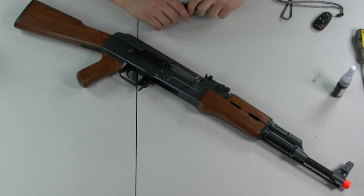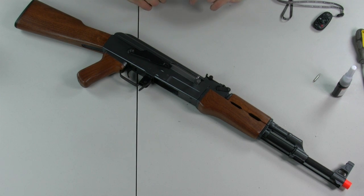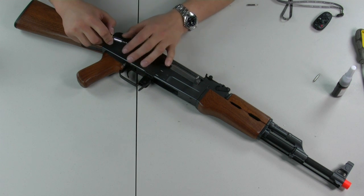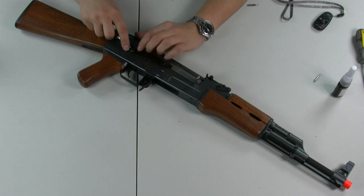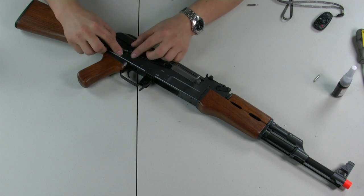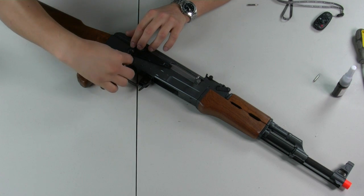Okay. So, in order to get the selector arm off, if you'll notice, there's a small round hub right here. You could pry this off with a flathead screwdriver or a prying tool, whichever you choose to use. Just when you do take this off, try and do this in a 360 motion. You want to be able to gently pry it off. You should get one side of this hub up, and then the other side, you should just be able to, like this, kind of pry it off like that.